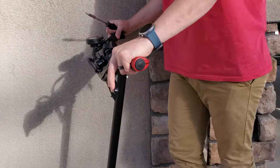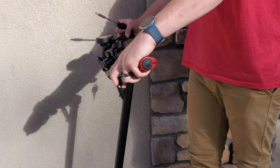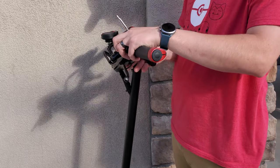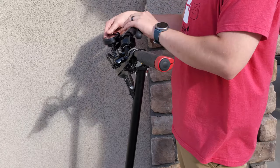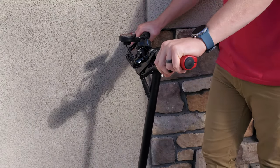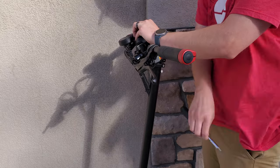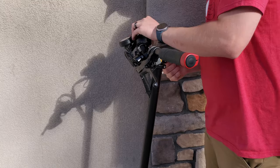Let's start with the brake levers. I like to slide my brake levers further to the middle of my handlebars so my index and middle finger can do more of the heavy lifting when braking. If you have hydraulic disc brakes, you should set up your levers so that your index finger can get as much leverage as possible. Well-tuned hydraulic brakes shouldn't require more than a single finger to fully activate, but if you like braking with two fingers then do as you please. I like to angle the brake levers down at a pretty steep angle because I'm taller and like a more natural angle. Leaning the scooter against the wall and standing on it to position yourself as you would while riding will help you find the angle that feels most natural and comfortable.